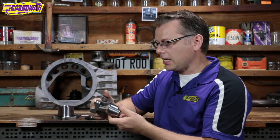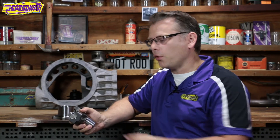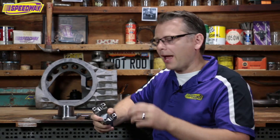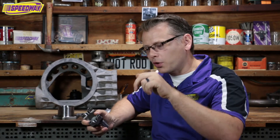One of the cool things about this is it's really easy to install. When I got my original Ford rear end home it was hooked to the torque tube and it had the wishbones on it, and I had to take it all apart — what a learning experience that was. I took the torque tube off and saw the closed driveshaft hooked to the rear end; it uses a little coupler to hold the two pieces together. That coupler has pins driven through it, and those pins are mushroomed. I thought I'd just grind the mushroom section off and drive it through — no dice. Those pins are severely mushroomed, so I had to drill them out enough to push them through. Be careful drilling that you don't drill into the spline portion of your pinion.